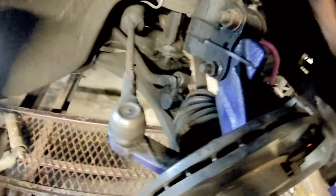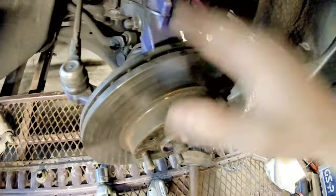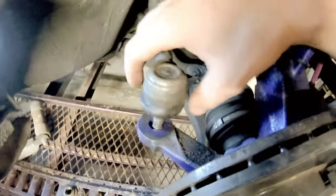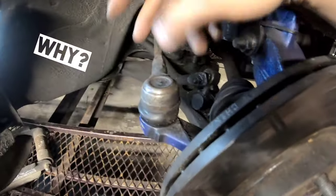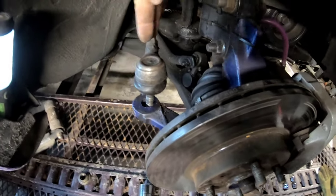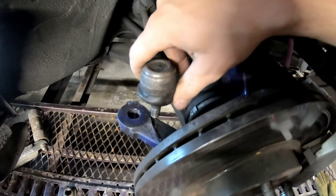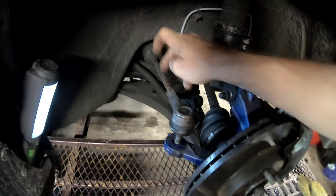Listen up. This is the hole that the tie rod goes in — that's what turns the actual front wheels. It goes back and forth, making the front wheel hub go left and right. The positioning of this tie rod is very important when it comes to the angle of the wheel, because of the actual pendulum. There's a pivot point down here on the ball joint, and the closer the tie rod is to the center where this ball joint is, the more angle the actual steering will have with the same amount of throw from the steering rack.